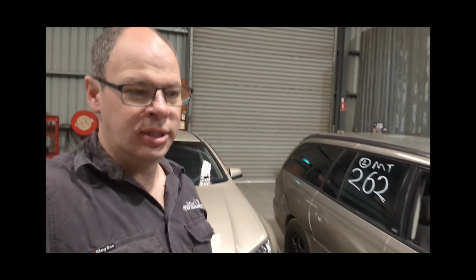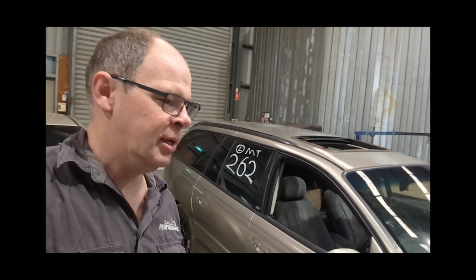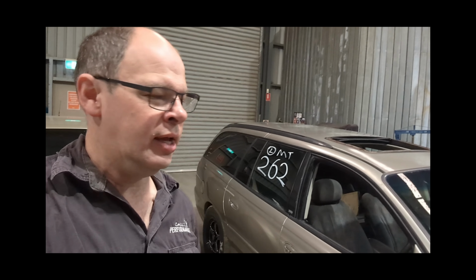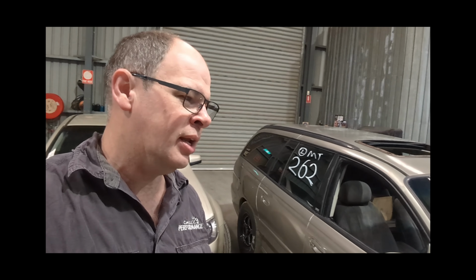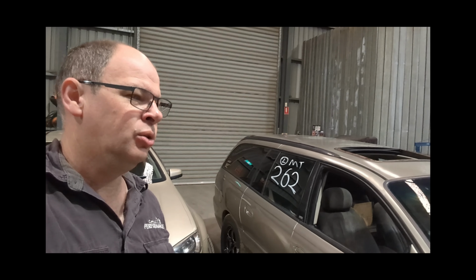It's actually got all the standard suspension in it. So standard springs, standard shocks, everything. There's nothing flash about the suspension, but I think the weight of the iron engine in the front has a lot more stored energy in the front springs. So when we launch it actually lifts in the front quite a bit, transferring a lot of weight to the rear, so we had zero traction issues, but the torque converter is a little bit tight. So the torque converter could be a little looser, and I've got 308 diff gears in it.